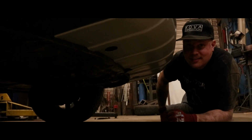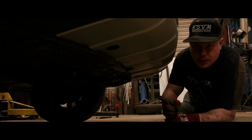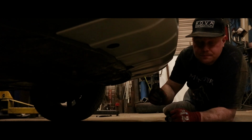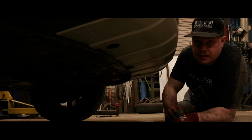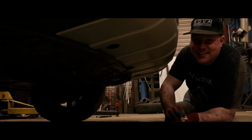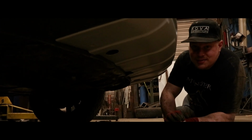That's 3 inches, guys. The tires are bigger than factory, so we get 10 mil there, and then we have a 33 millimeter block that gives us 43. Plus, I think the suspension was fairly drooped, so we got quite a nice lift. Dang, I wish we would have measured before we started.